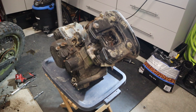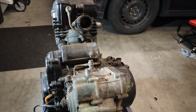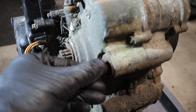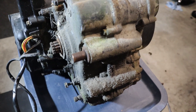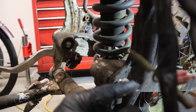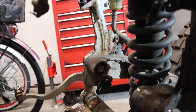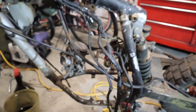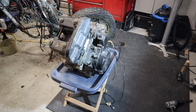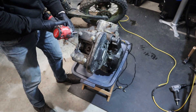Here is the engine in all its glory. Look at this thing - what a specimen. There was a lot of grinding. That bolt - the swing arm pivot was not seized in the case itself, it was seized in here. As this thing was spinning, it's just the inside of the bearing race that seized to the bolt, so it just can't get through. Lots of grinding. May have cut myself just a little bit, but don't worry - it was with a cutoff wheel, so it self-cauterizes. Let's whip this engine apart and figure out what failed finally. Let the real fun begin.